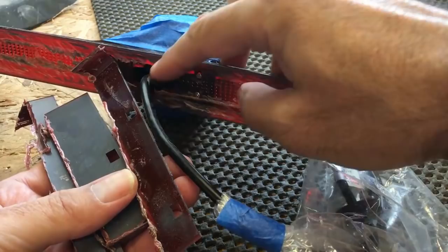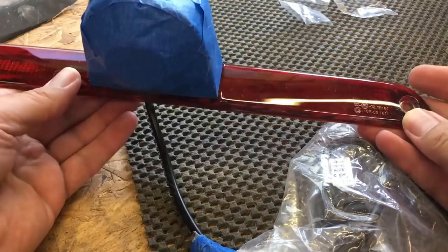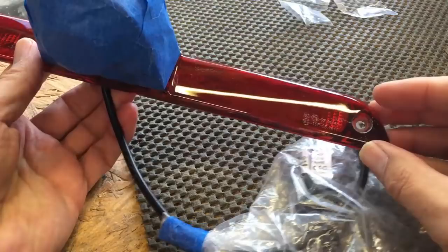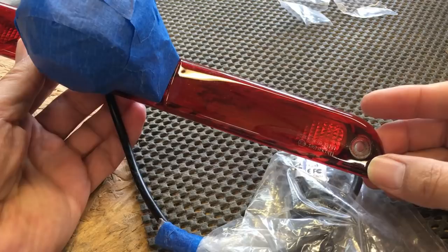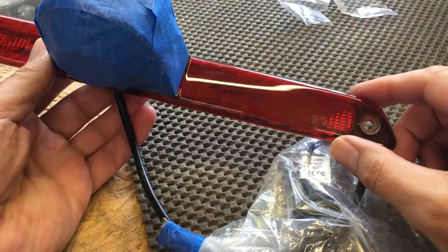Because this is not going to be a working brake light anymore, I want to paint it black. What I want to avoid is getting pulled over by the police if my top brake light appears not to be working. If I spray all of this black it won't look like a brake light anymore — it'll just look like a rear-view camera. I'm going to rough this up with some sandpaper because the surface is very shiny, to give a key for the paint to stick to, and then we'll spray it.